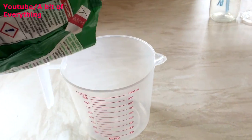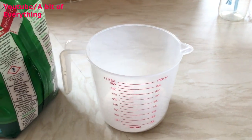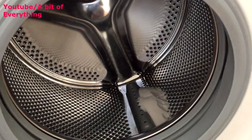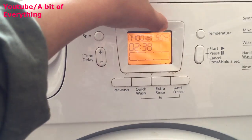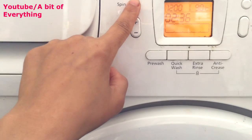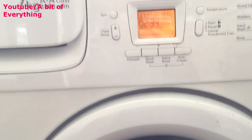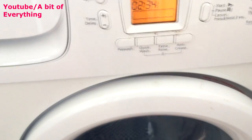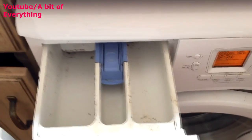You can also use it to wash the washing machine. You need to put in about one cup, roughly 200g, and just throw it in. Once you've added the soda crystals, put it on the highest temperature which is 90 degrees. The spin doesn't really matter — I'm going to do less spin. We do 90 degrees because bacteria and limescale build up when washing at 30 or 40 degrees, which is what they recommend nowadays.